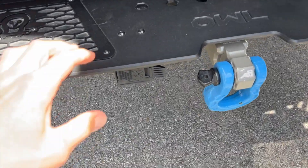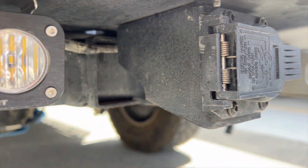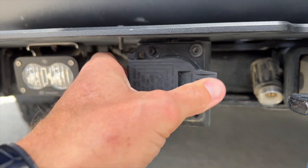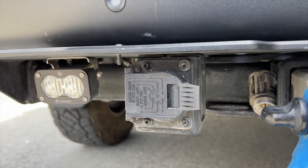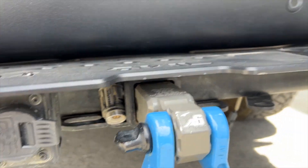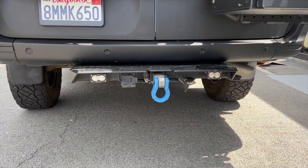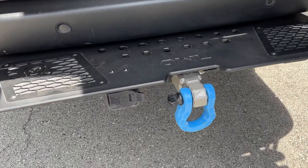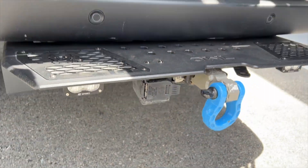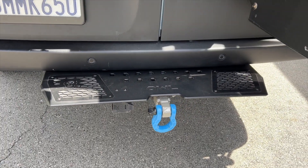Here's the finished product. We ended up drilling two holes in that bracket we cut off. You can see it ends up with a nice clean install. It's mounted horizontally now, which doesn't cause any issues — you just plug it in and it's really easy to access. You've got much better access to that hitch pin back there. All in all, it's like a 10-15 minute mod. You need a cutoff disc, a drill, and some quarter-inch bolts, but it ends up making the whole plugging and unplugging of trailers way, way easier.